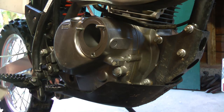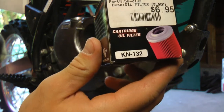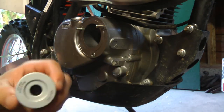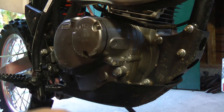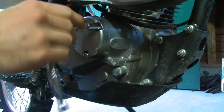For the replacement oil filter, I usually go with K&N products. The filter replacement number for this is KN-132. The open end inserts like so, then the cover goes back on. I forgot to mention — 10 millimeter is the size of these nuts.